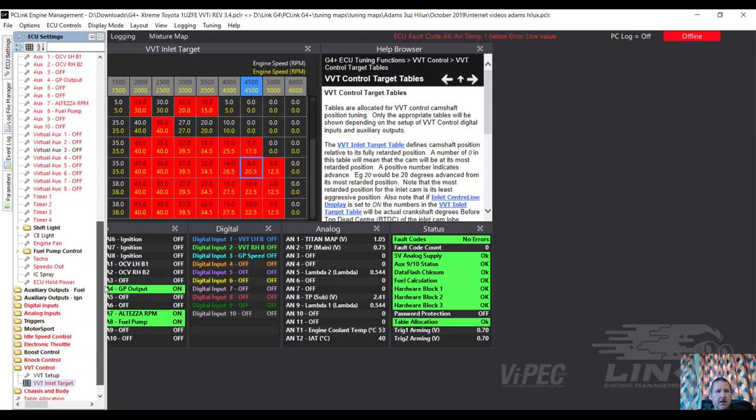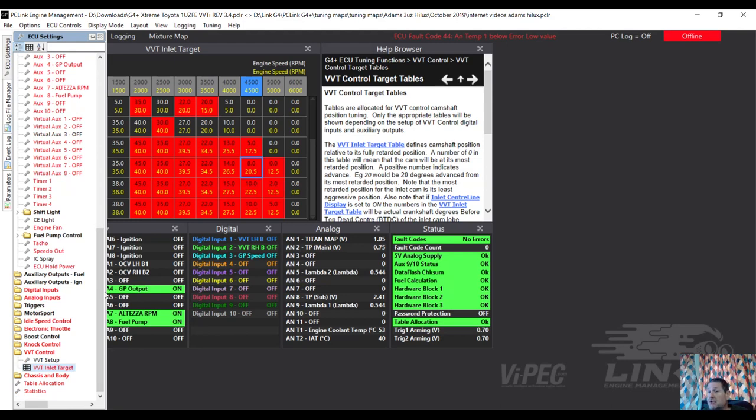Any tune development is really tricky when I'm on the other side of the world from where this car is. So for me the big step is to look at what's going on with the fuel - they're vastly, vastly different. I was going to show you the triggers - if I see big differences in timing maps I would pop down to the triggers. The triggers are the same; I would check the trigger setup and confirm the offset hasn't changed, where the base timing is, because that gives me a fair idea of what's going on.